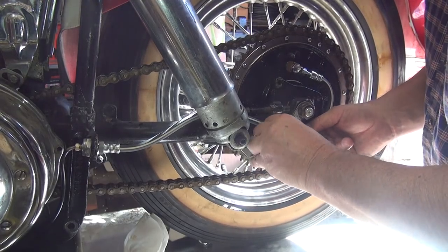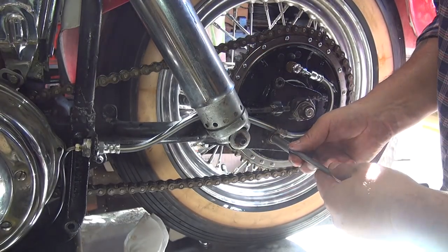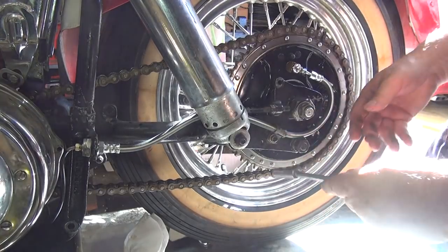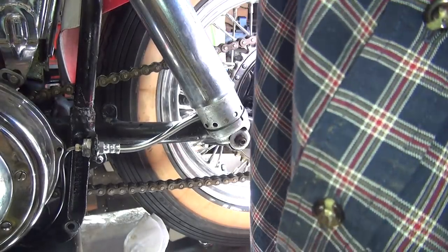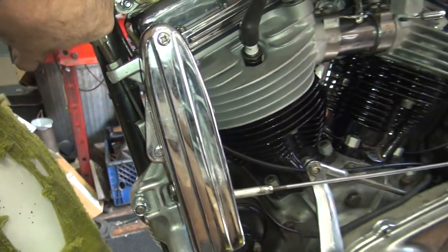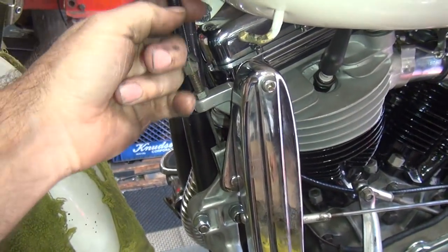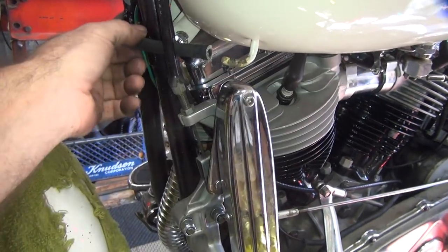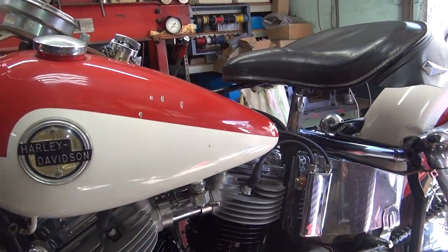Where's the crossover hose at? How did that crossover hose get way the hell up in there? That is not where it's supposed to be. Okay, this hose is a little bit short for your crossover - it's also very hard, so it won't hurt to be replaced. You can run them through the top over here if you want. I prefer running across the front because they have less issues. But we do have a cable in the way here. It just needs to be another inch longer.